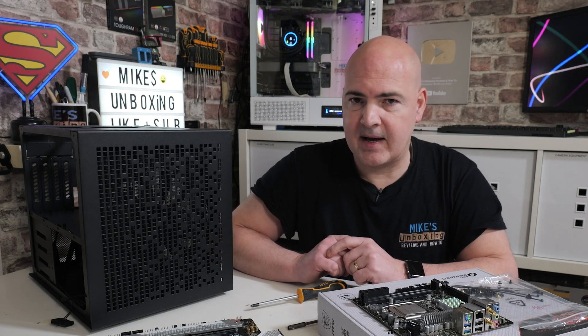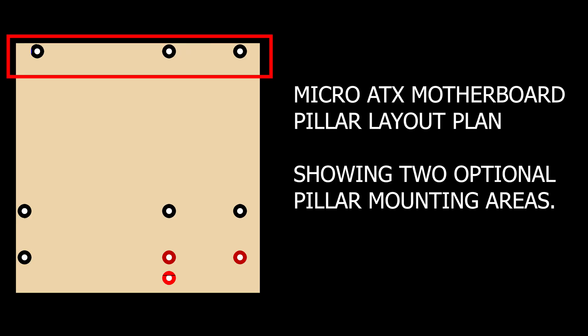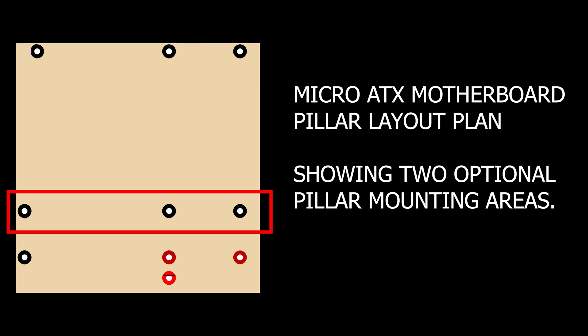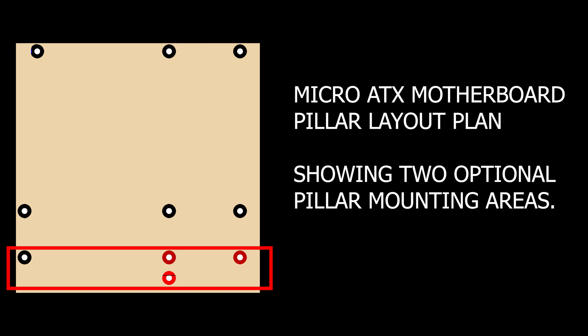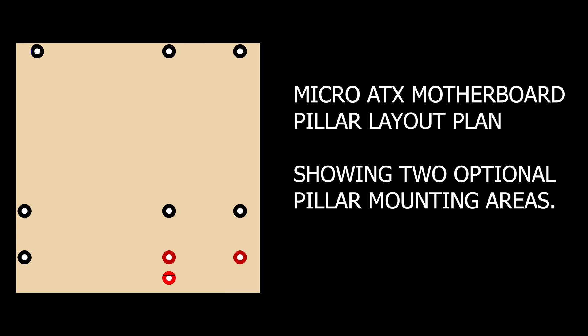Now let's look at the differences on micro ATX, which is the one which actually causes the most problems. With micro ATX, we have three pins at the top — the same as ATX — and in the middle, generally you also have those three pins. Due to some size differences on micro ATX motherboards, some boards may not have the outer two pins on the far right-hand side near where you plug in your main 24-pin power connector. Where it gets really confusing, or potentially can cause damage, is the bottom set for micro ATX. On the far left-hand side there's a single pillar, and if you run your finger straight across horizontally you should find another pillar at roughly the same height. Depending on your motherboard, some micro ATX boards have it about an inch lower.